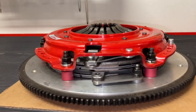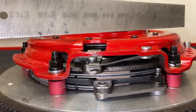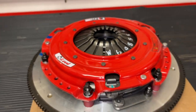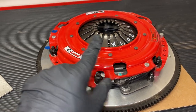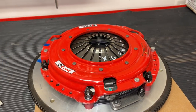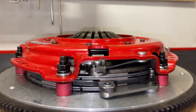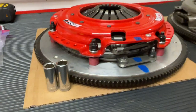You'll notice the big gap here that has to line up in that specific area — if it were clocked wrong and bolted down, you'd be smashing some of the straps and other components. You'll notice the diaphragm fingers stick up above the rim; when torqued down on the pressure plate they will suck down and sit lower. So you don't measure this right now, but when it's on the car we'll put a straight edge across it to make sure those diaphragm fingers are collapsed.